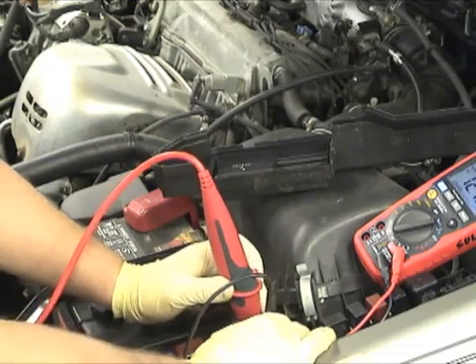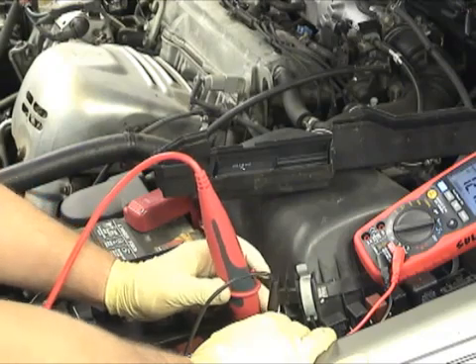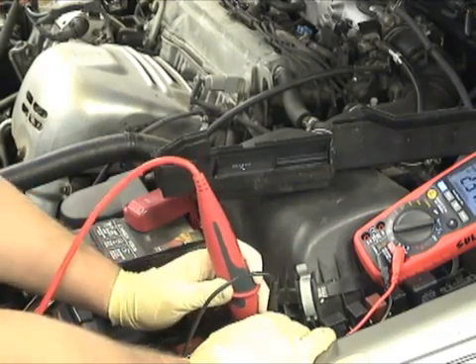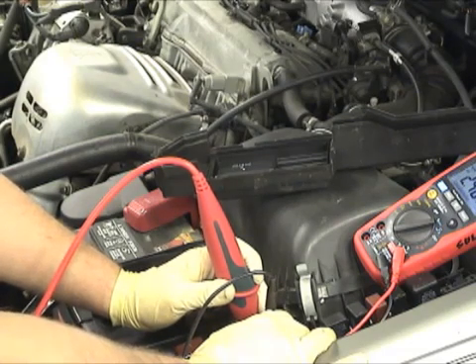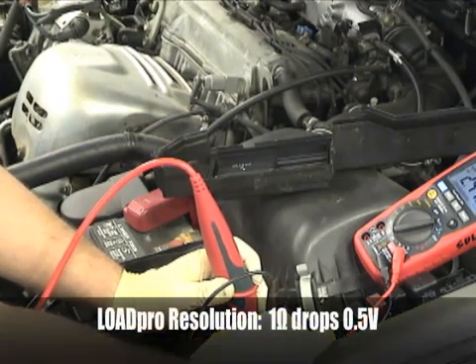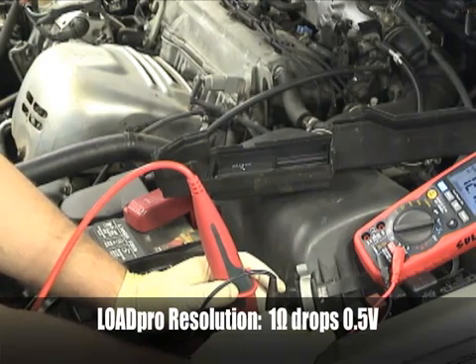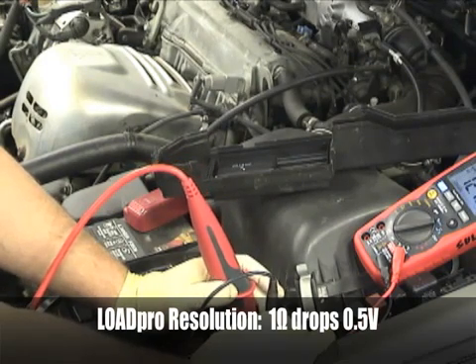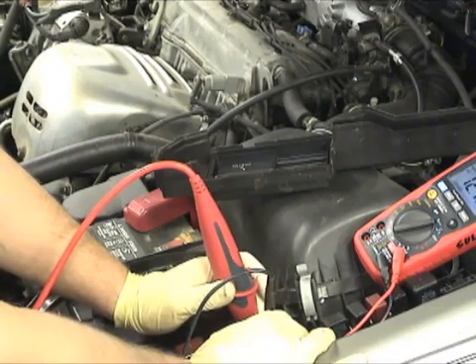Right here with 100 ohms, hitting the horn, we've got 12 volts. But now we input the load, and we drop our voltage down to 2.4 volts — under load. Instead of reading voltage, you're now reading loaded voltage. That's the difference. That's a huge difference.